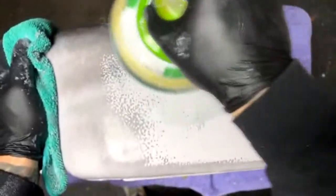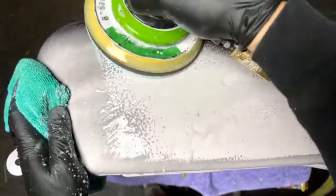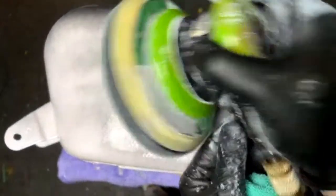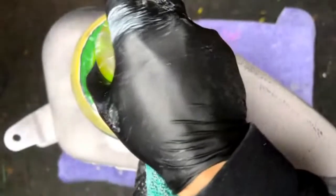Because there's this, which sounds good. Doing more work, because even though it's not going as fast, it's still going to do more work than if you were to crank this thing up. It makes a bigger mess, and it doesn't even do it. To be honest with you, it does less work and it wears out your paper faster. So I like to have it just at a hum, not that slow, something like this.